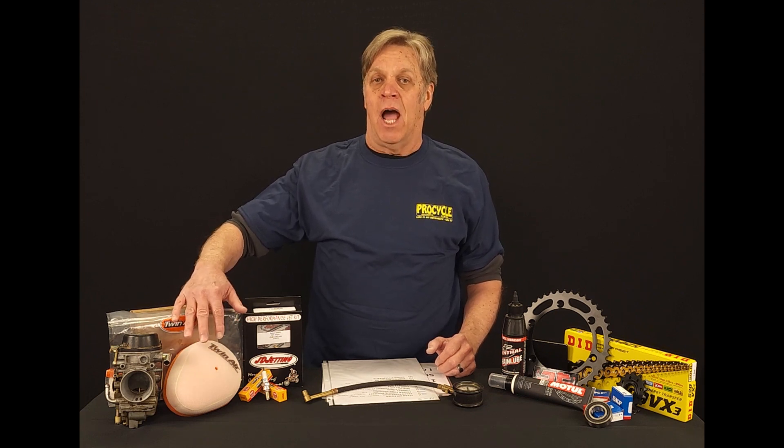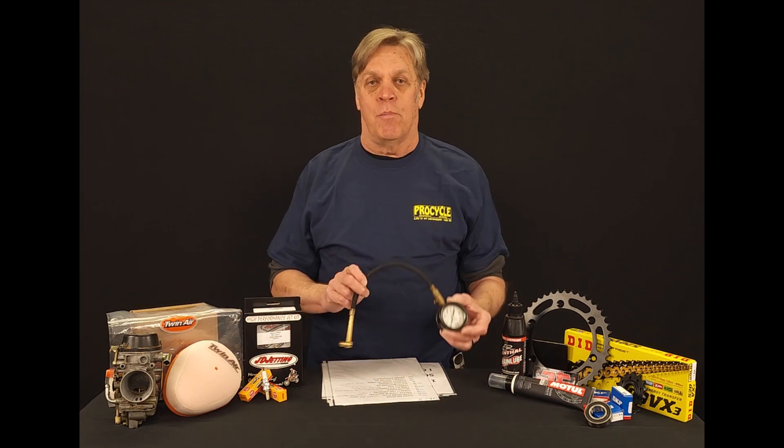The first thing that can really hamper good miles per gallon is a dirty air filter. You want to make sure you have a good quality air filter, get it cleaned and lubricated as needed — that really helps maintain high miles per gallon. The next thing to keep an eye on is tire pressure. We've seen too many times people who ride off-road and then get back onto the pavement without adjusting their tire pressure. You need street tire pressure to maintain good tire life, good tire performance, and to help keep miles per gallon up.